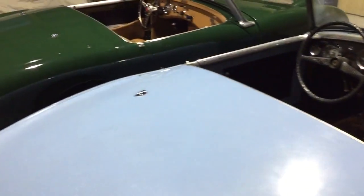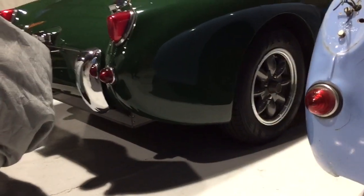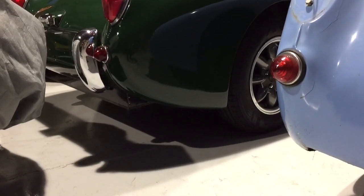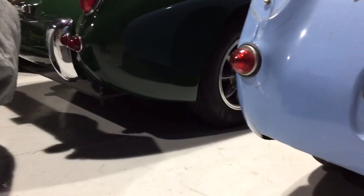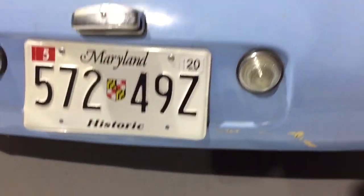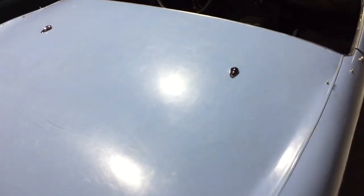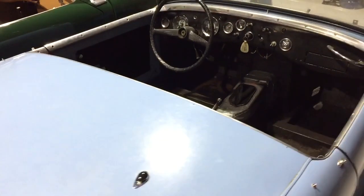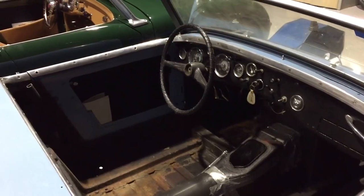In fact, you'll see here our first car. The prototype has a battery box under the trunk — you can just make out that black case in the back in between the bumper overriders that's holding batteries. Here we have the fuel tank removed and in order to attain the right weight balance, we fit just the right amount of batteries in the back to retain the roughly 50-50 weight distribution on these cars, which is what makes it so much fun.